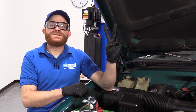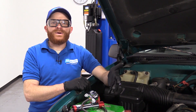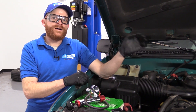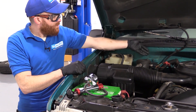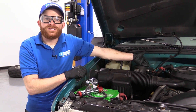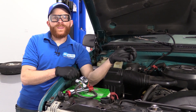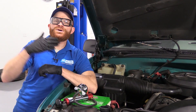There are two different types of leaks on a vehicle: internal or external. When talking about coolant, if it's an external leak, you're going to see it externally off the engine, on hoses coming off the radiator, or over by the firewall where your heater core is. If it's an internal leak, more than likely you're not going to notice any drips at all, but you will notice a funny smell from your tailpipe and possibly some smoke.